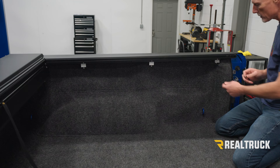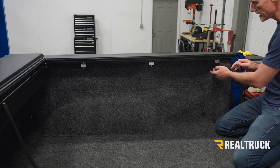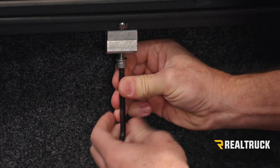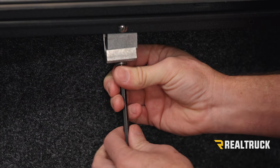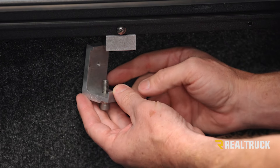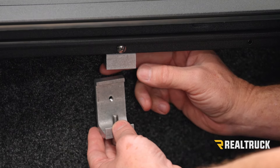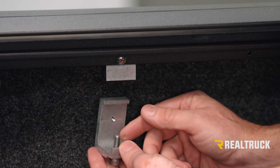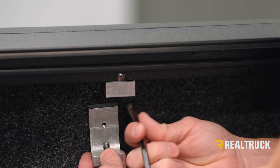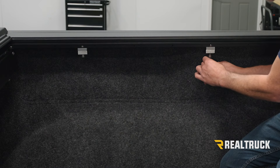I'm going to go ahead and use a quarter inch allen wrench to drop each one of these clamps. Some applications require different size tools, so whatever it takes to remove your clamps, use that. Now when I bring this down, I want to note this is a brand new cover so it's coming out nice and easy. But keep in mind this is a stainless steel screw in an aluminum block, so if it's been on there for an extended period of time it might be a little seized up due to electrolysis. If it is, it's often good to tighten it up a little bit and then loosen it back — sometimes they come out easier that way.